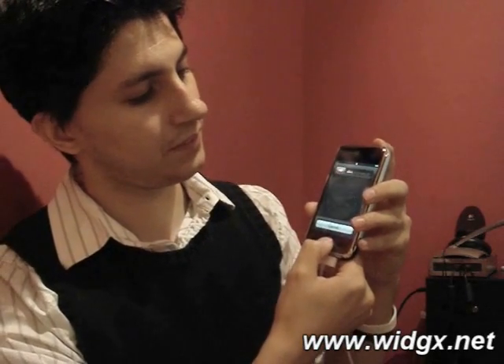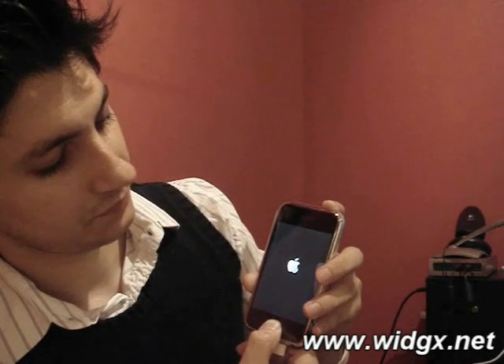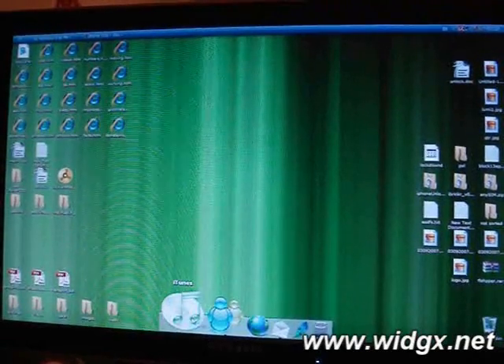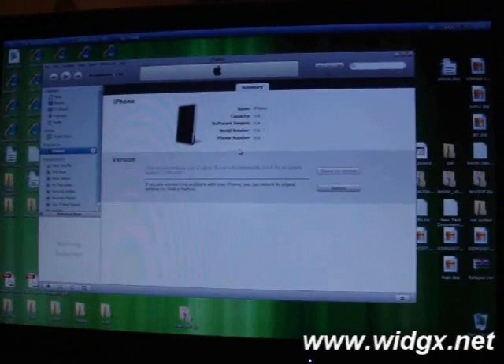I'm going to show that to you in a moment. What you're going to do is press the top right button and also push the Home button, holding them simultaneously for around 25 seconds, or at least until you see the yellow triangle. So I'm going to do that right now. Holding it... You're going to see a yellow triangle. And as you can see, it says 'please connect to iTunes.' So now I'm going to launch iTunes. It's going to tell you that iTunes has detected the iPhone in recovery mode and tell you that you need to press OK, so just click OK.